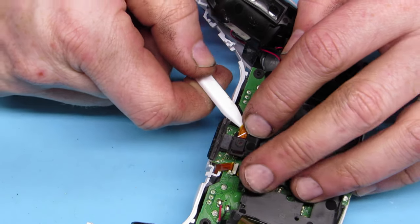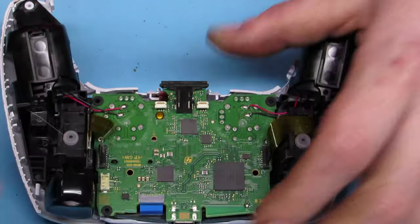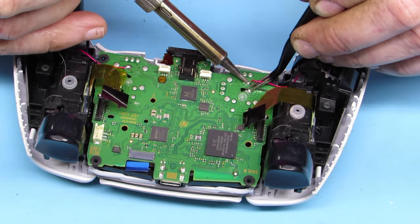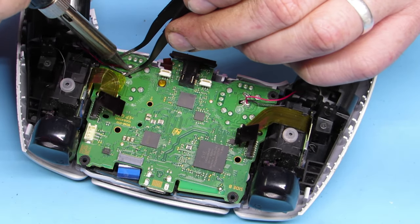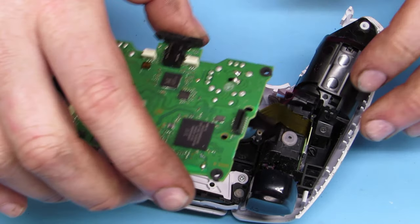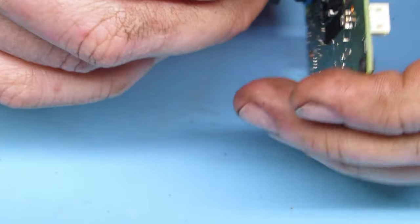It has a ribbon cable, so you want to get that ribbon cable up. Then we're going to pull all the other ribbon cables — there's another one right there, super tiny, so take your time and get a nice grip on them. Top ribbon cable, and then the side two for the L and R buttons. Now we're going to unsolder the two leads — the black is always on top, the red is always on the bottom. Those are for the vibration motors, and that lets us pick the board up and out freely. You don't really have to unsolder those, but it's a lot easier, especially if you're replacing the thumbsticks.